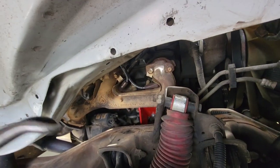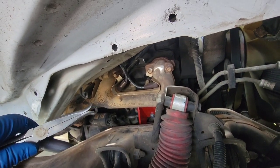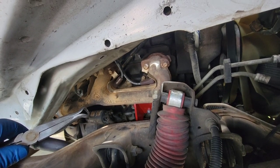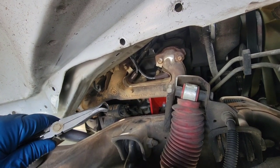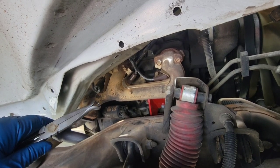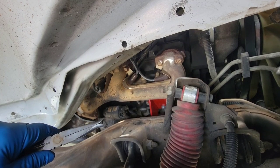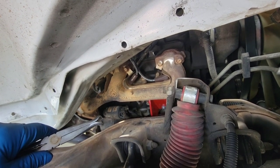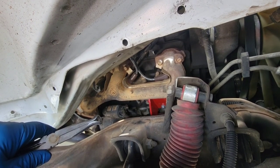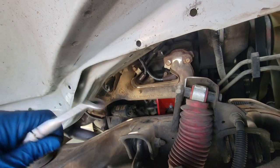Let's keep working. Got these pliers here — I'm going to try to use them with these plug wires. You want to be careful; I just put these in. Last thing I want to do is pull my plug apart. You want to be able to reuse these plugs. I've done it before, but usually with wires that have been in the van a lot longer — the rubber slightly deteriorates, things get stuck, and you got to pull the wire and it just rips apart and then you've got to get new wires. Let's try to avoid that.